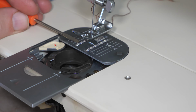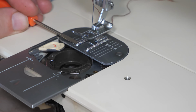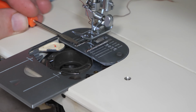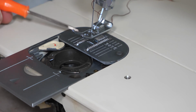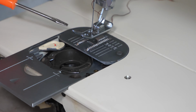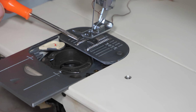And now they'll reset. And this stitch is another stitch back. And then this time they don't move. And now they move back again. So the cam link to reverse the stitches for the stretch stitches and stuff is somehow out of adjustment, so that I'm not getting full feed length travel of the dogs front to back. And then on the plain stitches, it is occasionally not feeding fabric forward.